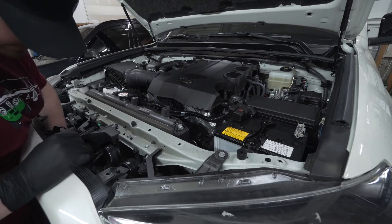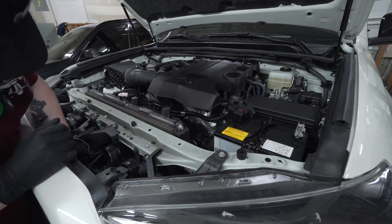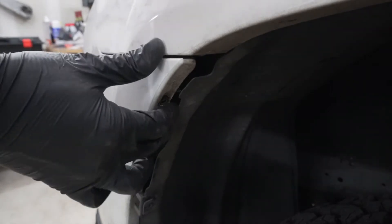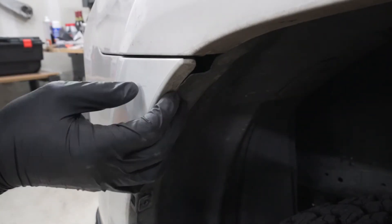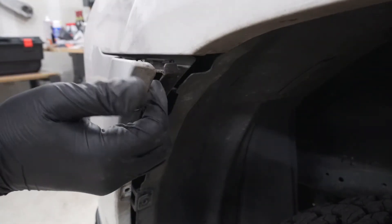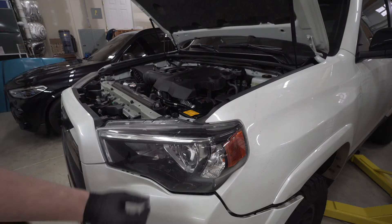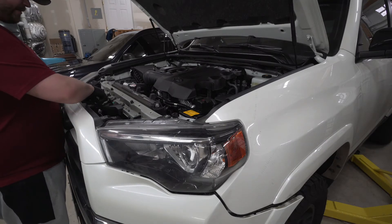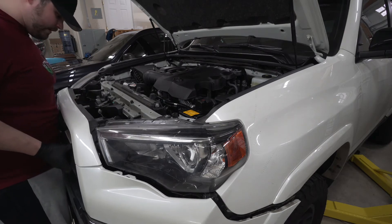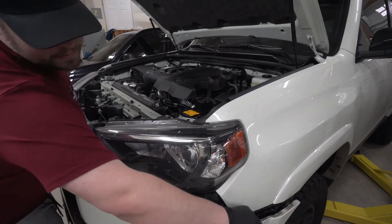On this particular vehicle there's a wiring harness down here for the front module, so go ahead and undo that. Next, start pulling off the bumper cover. You'll see there is a nub — pull your bumper cover over that and it will start to pull away. Now that both sides are pulled out and all clips are removed, remove this last 10 millimeter in the center, and then this entire front bumper comes off.